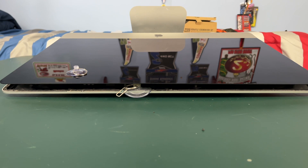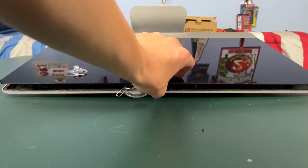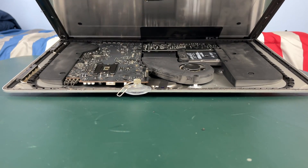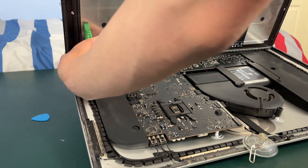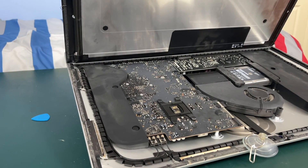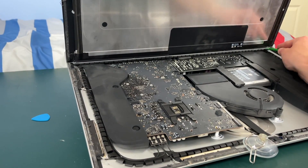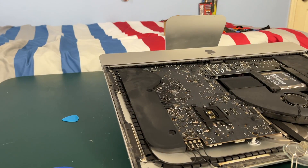Now that you have it all disconnected we can lift up the display. It's going to be a little bit difficult at first — you're going to feel some resistance but don't worry, it's just adhesive at the bottom. You're going to see a piece of adhesive in the bottom left corner and you can pull it up and start undoing the adhesive of the screen. If it tears, you're just going to have to pry a little bit more. There was also another piece where you could grab the adhesive on the right side of the display that might make it easier for you.